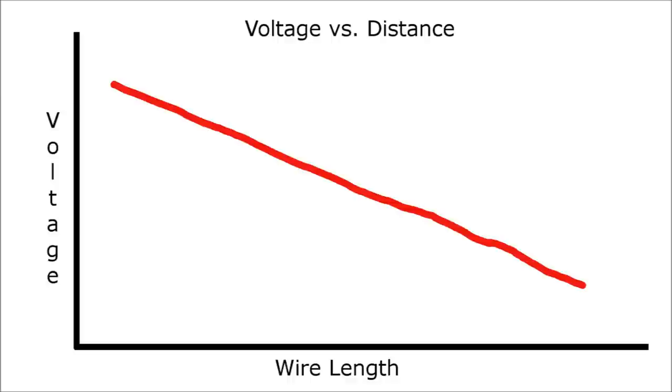Here's another reason why you need to do this: how do you get that higher voltage? As you can see on this graph, the longer your wire length on the x-axis, the greater the resistance, and therefore the lower your voltage. One of the keys to the relay when you install it in your vehicle is that it allows the power to be drawn from the alternator or from the battery. For most cars it's best to run it straight off the battery and right to the headlights, since most cars have the battery right up at the front. That allows you to have a lot less voltage drop across the wire, and relaying your headlights alone is going to be great for increasing power output.